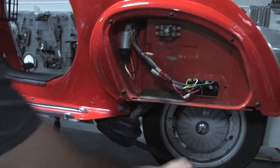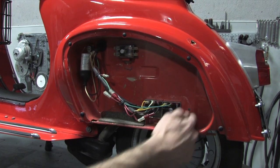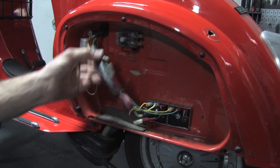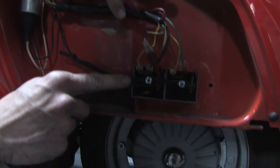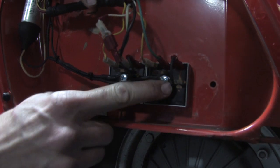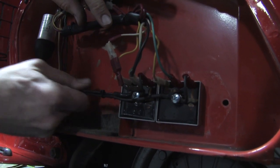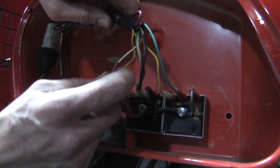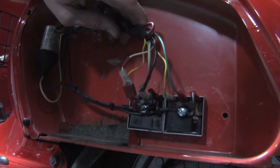I've removed the battery, disconnected the wire that went to the fuse holder — there were two fuses in there — and removed the regulator. You can see where the regulator went; it's a pretty similar location on the other 1973-74 Vespas. The wiring harness has the same colors on any of them. Starting with the grounds: this is the black wire that originally had a terminal grounded at the regulator and another ring terminal grounded at the battery. I tied both regulators together and did two quarter-inch quick connects to the ground terminals on each regulator. There's also a third black wire that ties to a white wire with a little red marker — or some have a white wire with a red trace — and you now want to ground that. Originally that went to one of the terminals on the regulator; now we're grounding it.